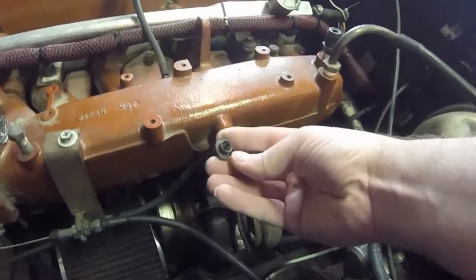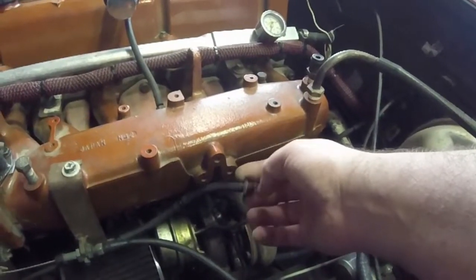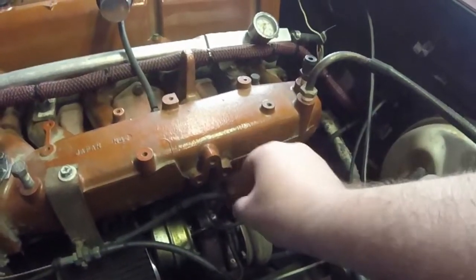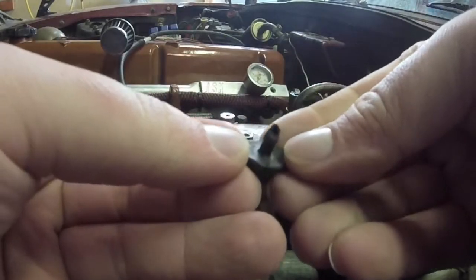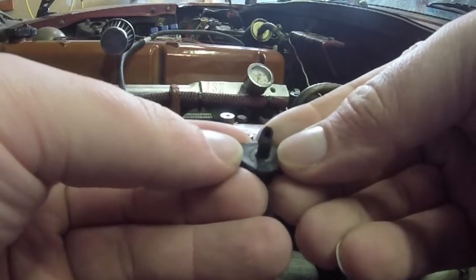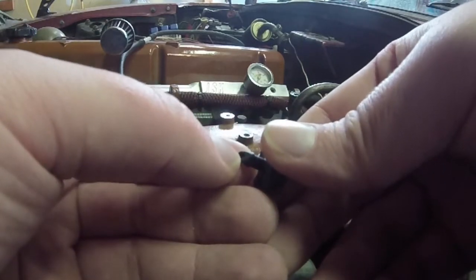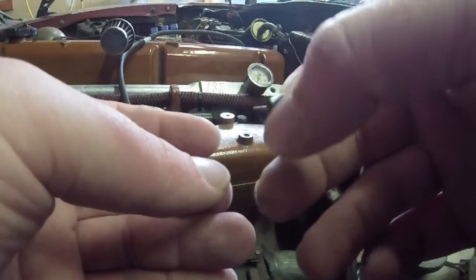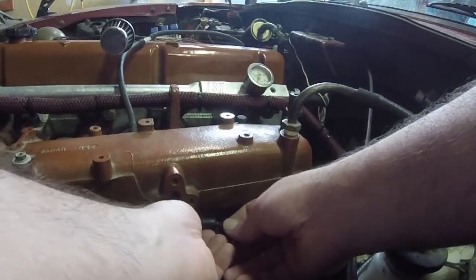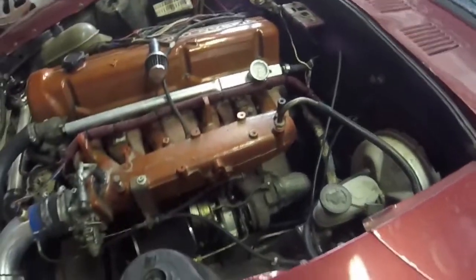What I've done, and this is really cheap — I've just taken an old garden sprinkler drip system cap and just plugged the hole. It's still a really tiny hole. This is just a bleed valve. All it's doing is letting the size of this hole bleed off air from that pressure line so there's not enough pressure to open the wastegate. This is a very manual bleed valve — you're basically setting a set flow. If this were to fall out or fail, I'm going to have a world of hurt because my wastegate would then produce as much pressure as it can. Very bad.